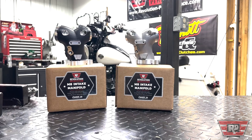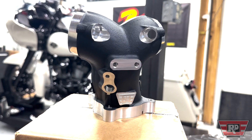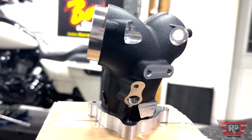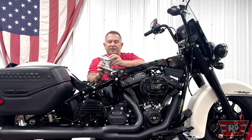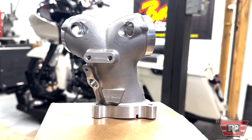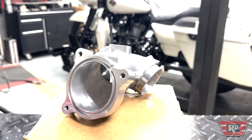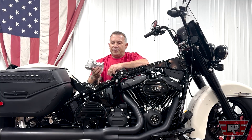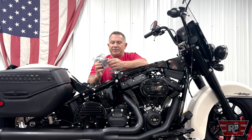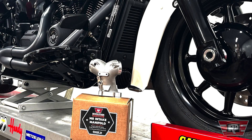It comes in natural and it also comes in black. The black is powder coated and highlighted with aluminum highlights. The natural one, we actually vapor blast the outside of it. The reason we vapor blast it is it kind of finishes the pores in the aluminum, so when you touch it with your hands, grease doesn't stick on the aluminum — it's just got a little different finish, just natural. These things lend a little horsepower, a little torque gain. Put them with heads, run them with the stock throttle body, and make some nice improvements over stock.